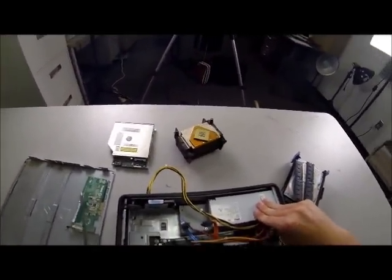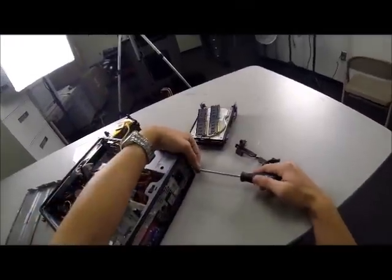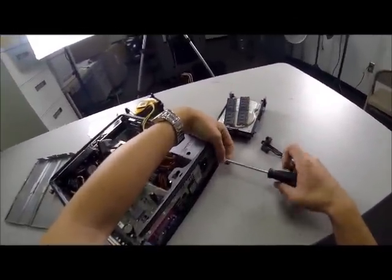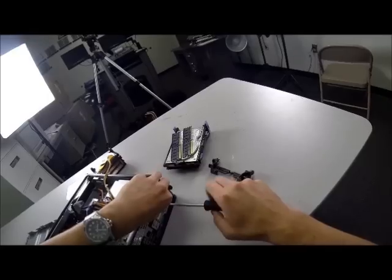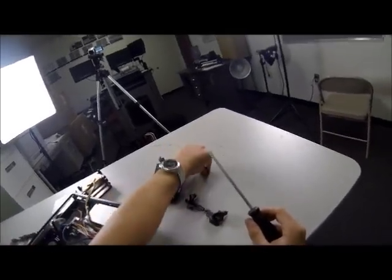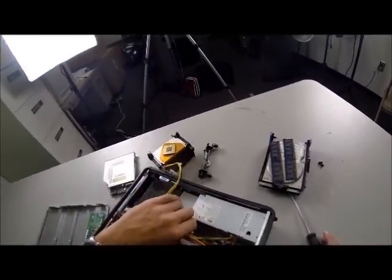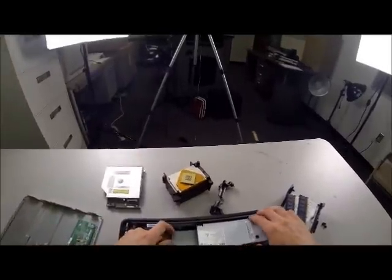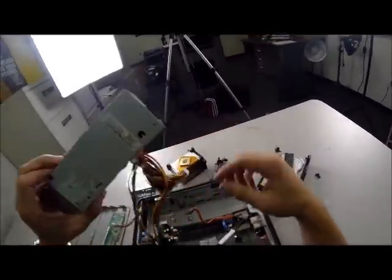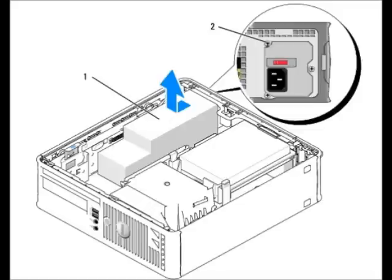You can't just slide the power supply out — it's screwed down. To remove it, there are three screws at the back. We'll need to remove those before we can continue. When you're done with the screws, put them all together in one spot so you know where they are — it sucks to lose screws. Now that we've got those out, we are going to slide the power supply forward. It slides forward and you hear a little thunk off the mount. Pick it up, lift it out, and make sure it's not wrapped up on any wires.